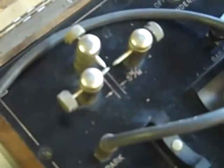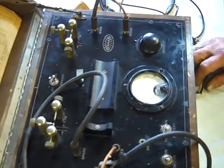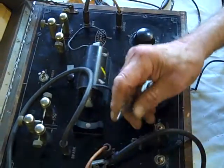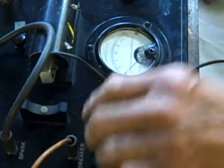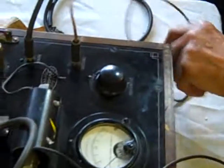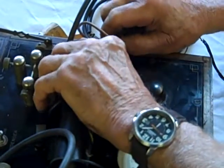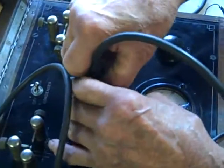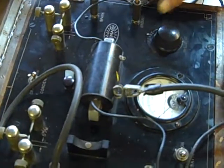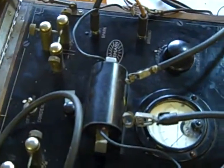We'll put that point down, turn it off, and then we'll put in a dual winding coil, which is capable of handling two cylinders. We'll hook the breaker up to one side of the primary, and then we'll hook the ground side to the other side of that primary. This is the high-tension output, so we'll put the left side on — that'll show where your spark will be coming from. We'll turn the motor on to the AC.